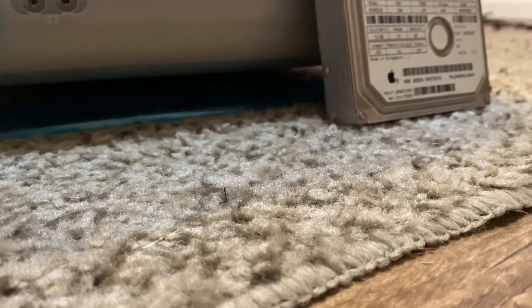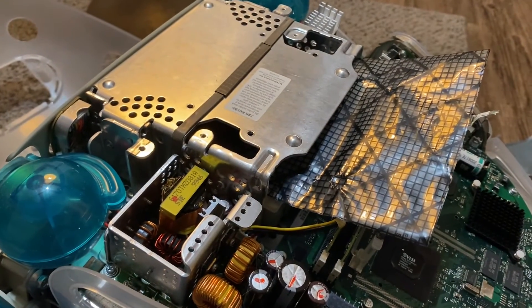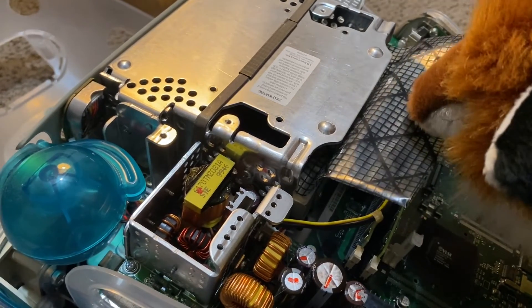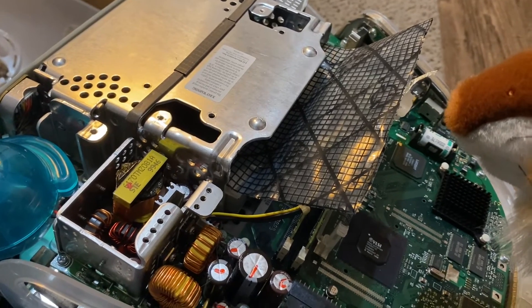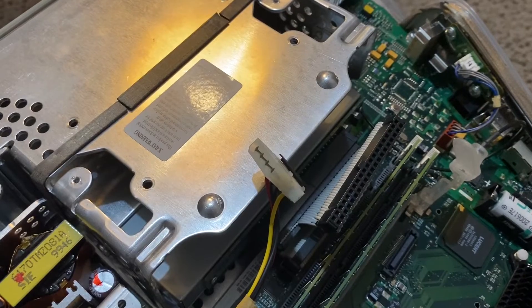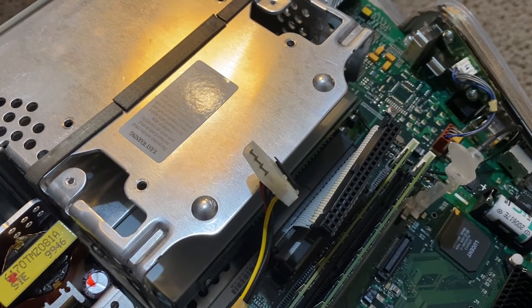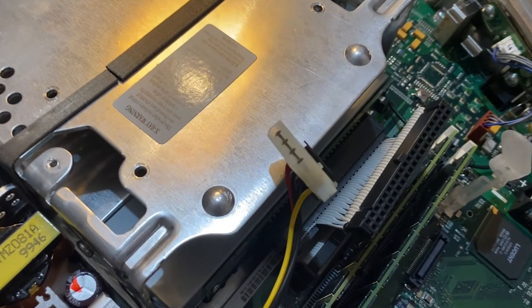Once the drive is out, keep it on hand just in case something happens to your solid state. The IDE adapter itself comes in a little plastic bag — what I like to do is take the bag and put it inside the drive bay so that the exposed circuitry does not touch the metal drive bay. This is probably a bad idea, but it's worked for me. Once the CompactFlash storage device is in the adapter, simply connect it up using the IDE adapter, then take the Molex adapter, plug it into the existing IDE floppy power connector, and hook it up to the device.